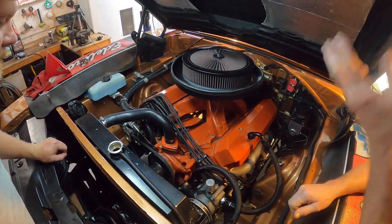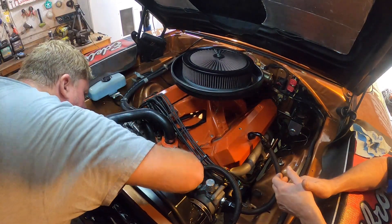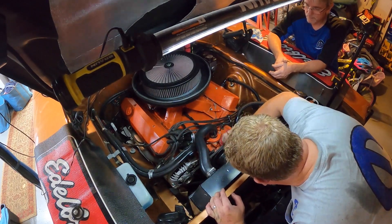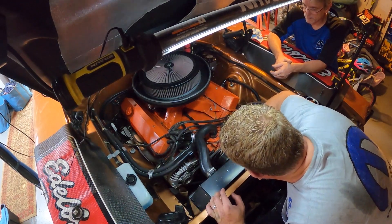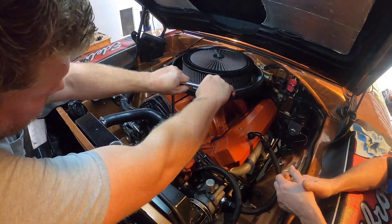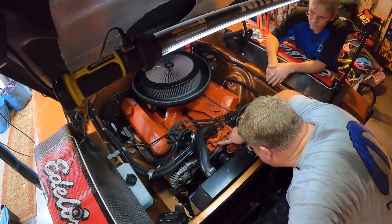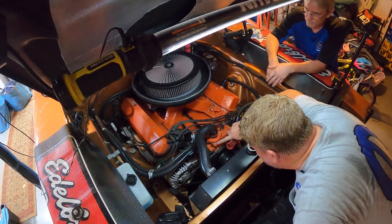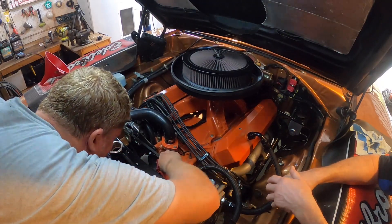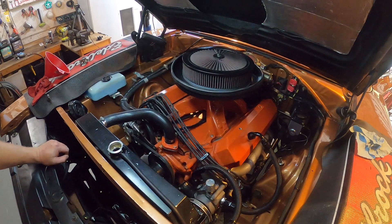There's no thermostat, and with the pressure change it's going to be - oh, look at this, is it seeping already? That is seeping already, that's ridiculous! I don't understand why they're so hard to seal - it was pretty tight. You're pulling in the aluminum. That one's just got a warp in it I guess. This thing's leaking like crazy - unless it's got a crack, it's coming out right there.